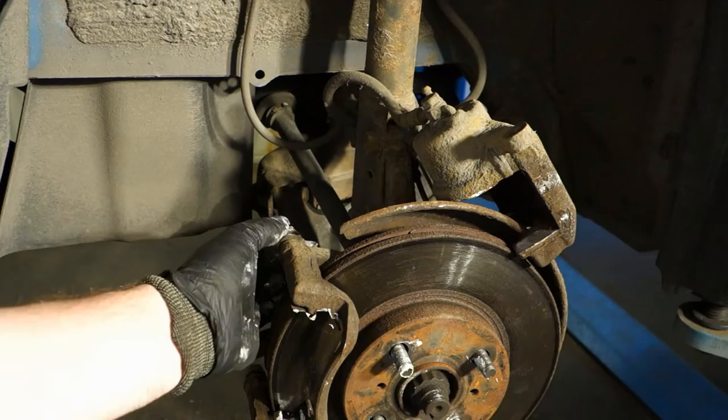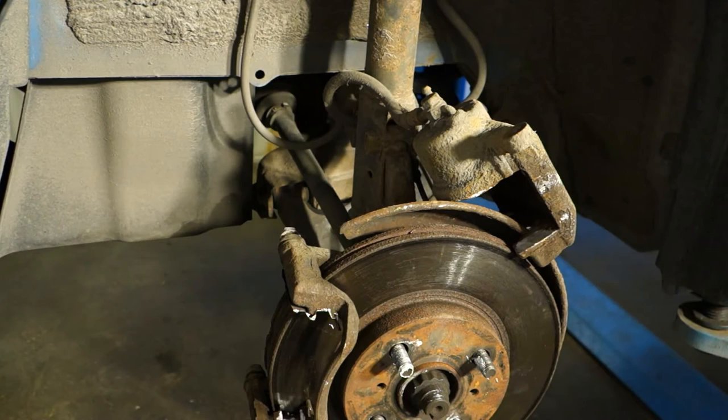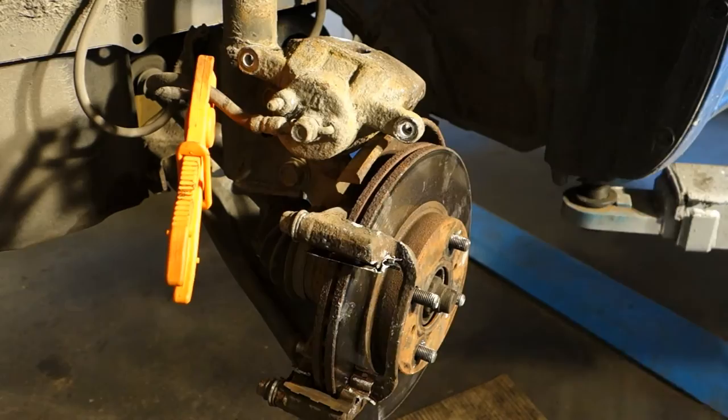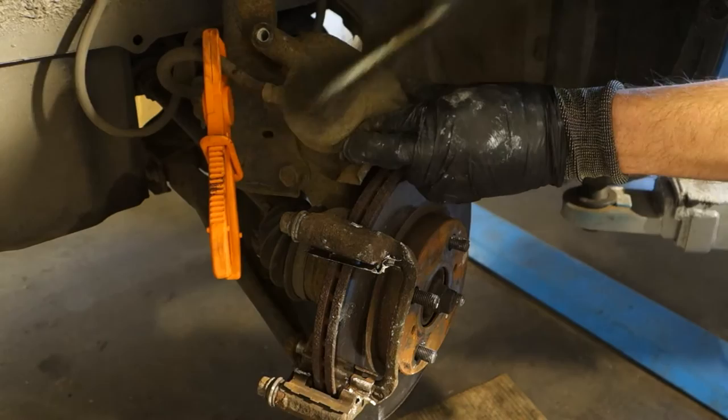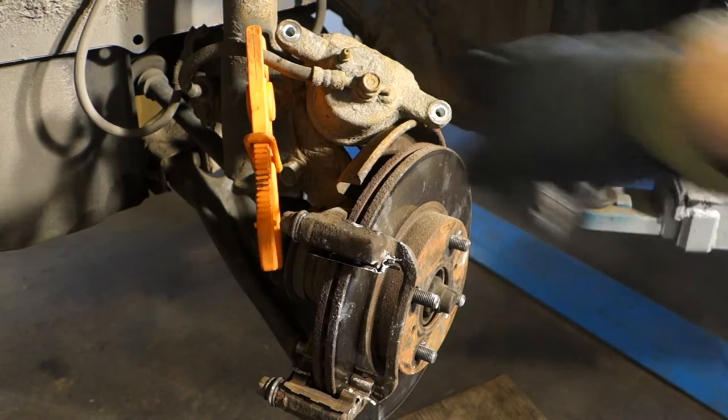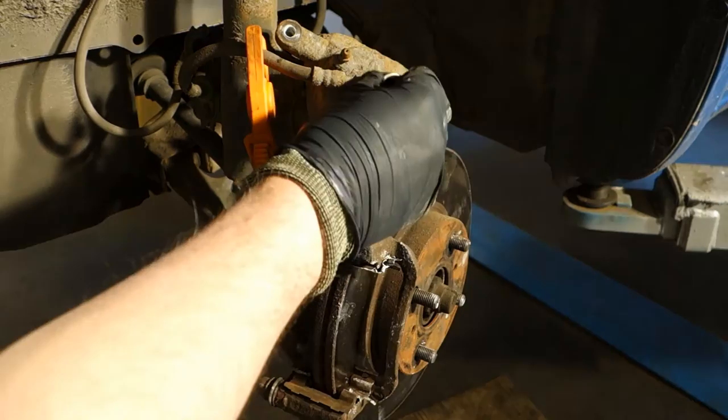So easy. Okay, and now I think I covered all of these main areas. Then I need to open and take this brake caliper away, and there is this bolt, but I need to first clean it using this metal brush, because it is full of sand and dust. I think this is a 14 millimeter bolt in here, and yes, the 14 fits in here.